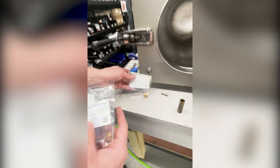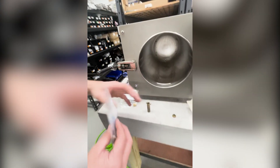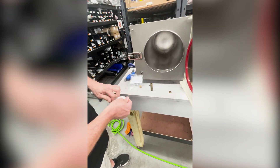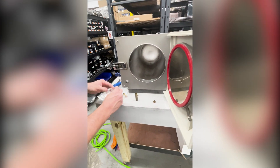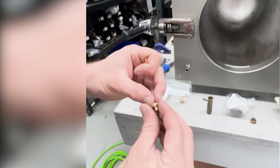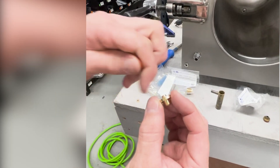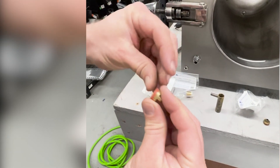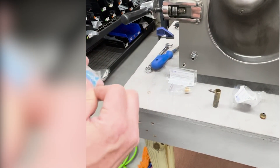I am changing out the door bellows using the RPI kit, the TUK030, and the bolt will be the TUB034. I am going to reuse the sleeve. First thing, remove all the contents from the package. The way this goes together: you have a thinner side — a short side — and a long side. I'm going to put that on the short side so it's nice and flush.